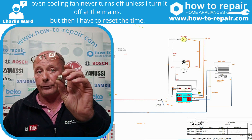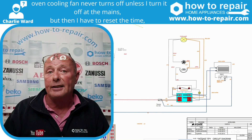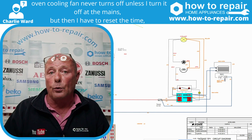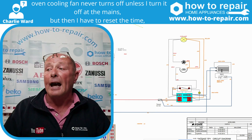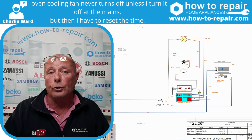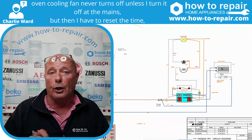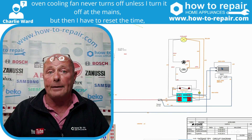Your thermostat might be different to this one, but it's the same principle. This thermostat is designed to cut in at 70 degrees centigrade. This means as the cooker warms up and gets to 70 centigrade, this thermostat is activated and therefore the cooling fan will start running. It will continue running for the whole cooking cycle. When you turn your cooker off and finish cooking, this cooling fan will continue running for about 20 minutes after you've turned the cooker off. Then, as the thermostat cools down, it will disengage the fan motor.